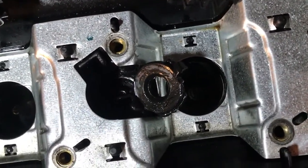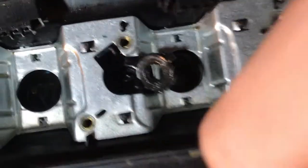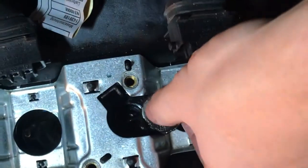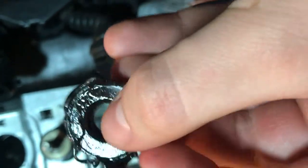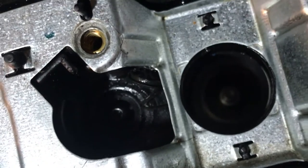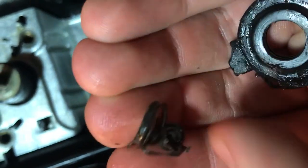Taking a closer look at one of these bolts — when you take it off, make sure the rubber washer also comes off. In this case it didn't come off with it; I was able to get the bolt and the metal washer out, but as you can see it's covered in silicone that I need to remove since I'm reusing it. Inside here it's not as bad as the others, but it's still leaking a little bit of oil. So yeah — don't use regular silicone. That's the lesson here.